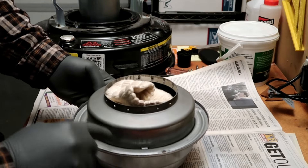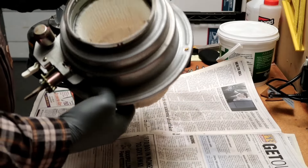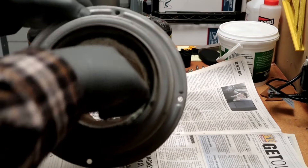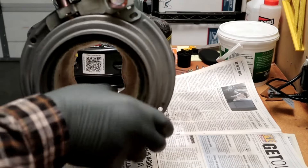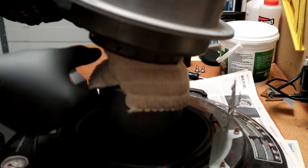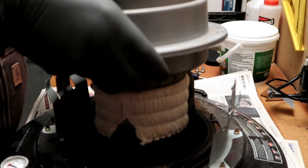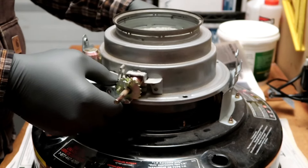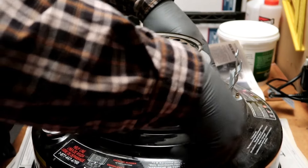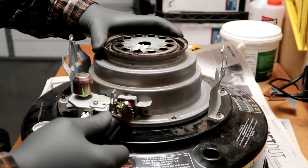Reinstall the lower wick compression ring — it has a nice little fitting, it just screws onto the lower housing. The trick now is you've got to hold all those metal pins in their proper alignment while you put the wick back over the igniter housing. This isn't that bad either — it went pretty slick. Just put your hand inside and press it out to hold all those metal dowels in, and it's a pretty easy, nice tight fit as it's supposed to be.